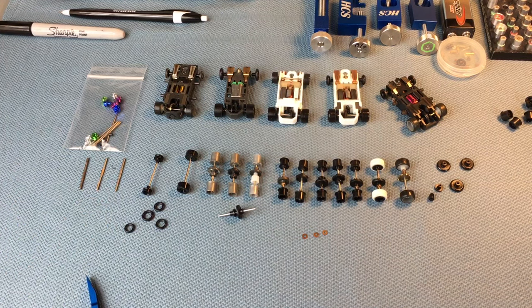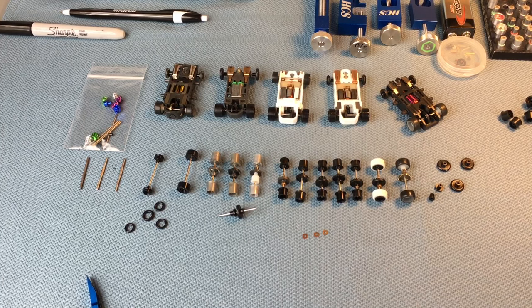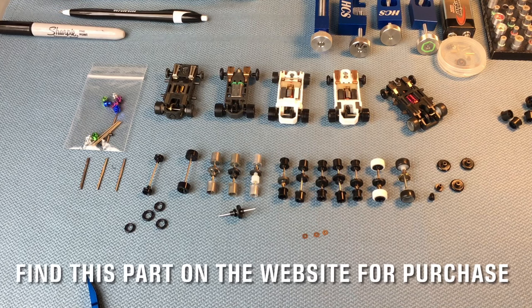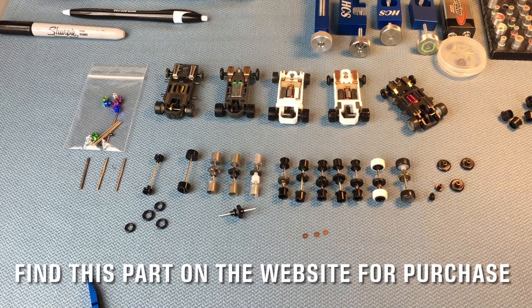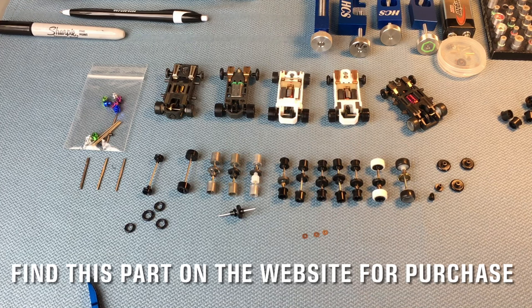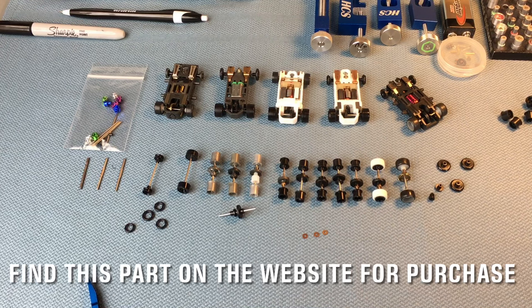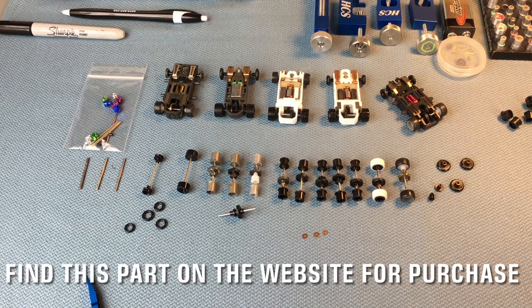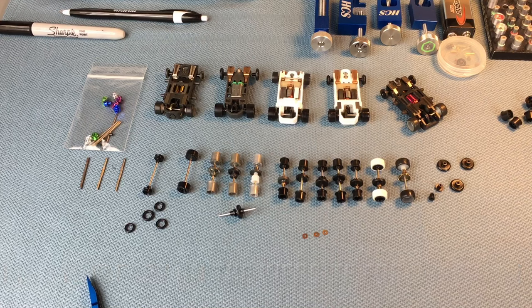That was an expensive part but it wouldn't hardly last. So when Dan out at Viper came up with a hard spline axle - basically a steel axle that they surface harden and then chrome plate - I've yet to bend one of those axles. I've had zero complaints reported from anybody about those axles getting bent. Does that mean the axles haven't bent? It could be we've just not had any complaints. It really solved a lot of problems and truly became one of my favorite parts.